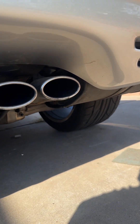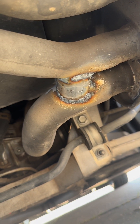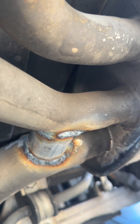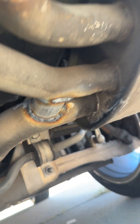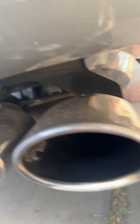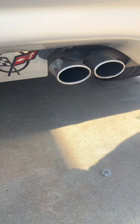The car's off. As you can see, this is where we welded that piece on — we did it on both sides. I told the guy to cut a one-and-a-half inch hole on both sides and just weld the pipe on there. That's basically all you have to do to bypass the muffler. Here's the view from the top — it doesn't look very different, but just that little thing can make a difference.